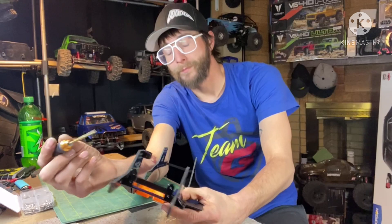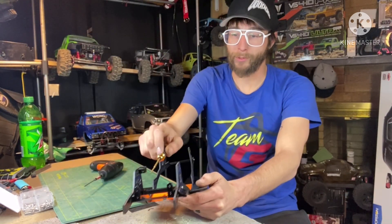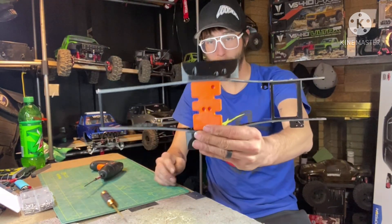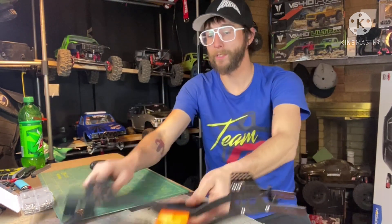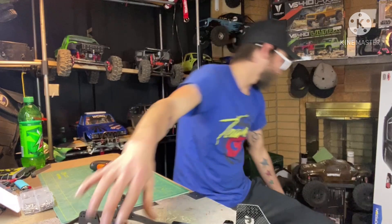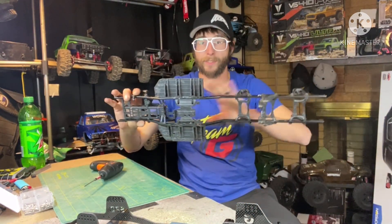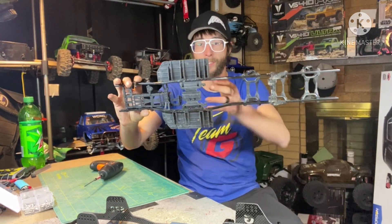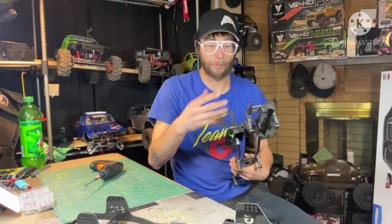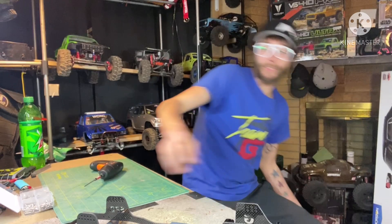On the inside it'll depend on your servo mount choice and your servo size. With the lay down mount you do have some more leeway there. A lot of people are firm about the pinching technique, but here's a 6x6 chassis we just did. If you look at some of your stock chassis - wide from there, then they go narrow - once everything's together it's already pre-stamped and pre-bent and you just don't really notice it. But right here, you are making that shape.